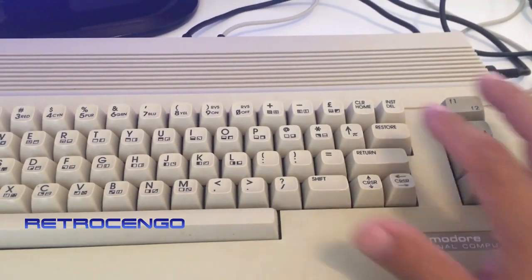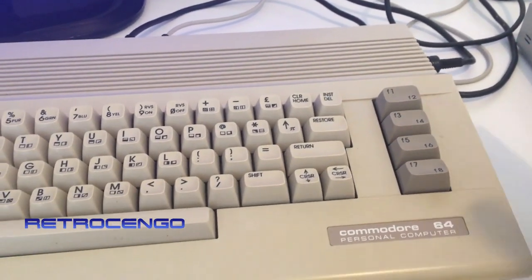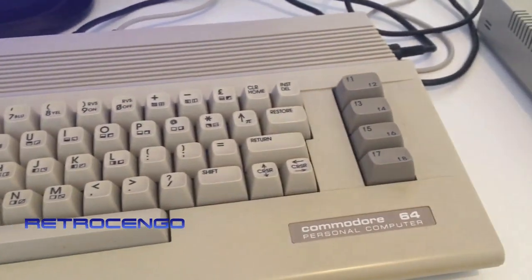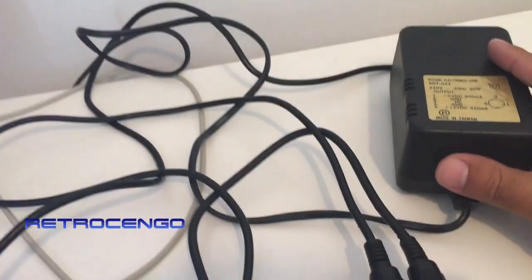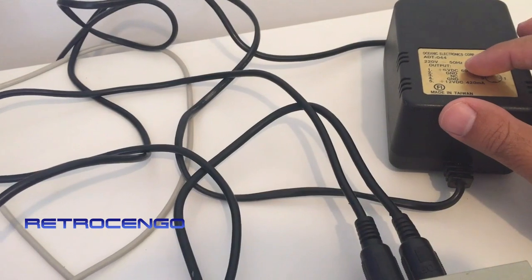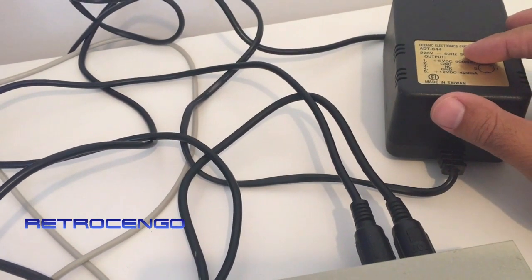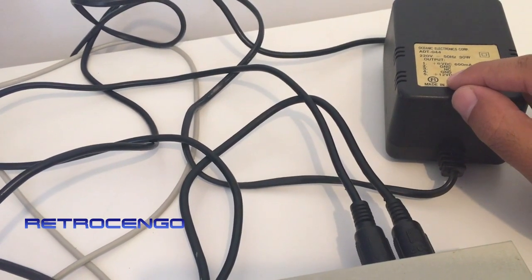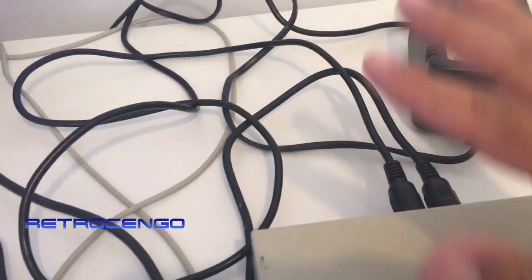I really love this machine because it was my first computer. I had a white one with a white keyboard, a bread bin model, so I'm looking for that one. I measured the PSU and pin one says 5.01 volts — that's great — and pin five says 12.32 volts, so that's alright.